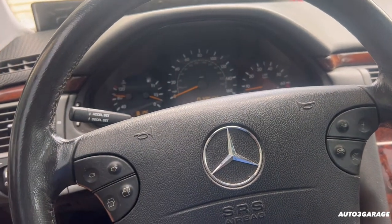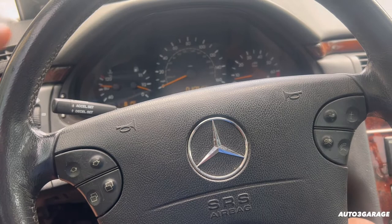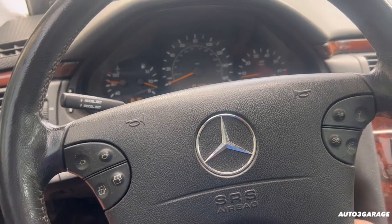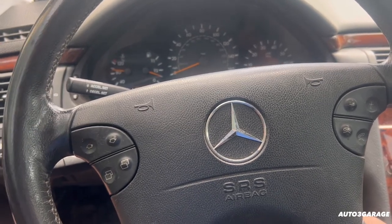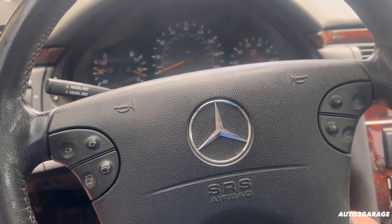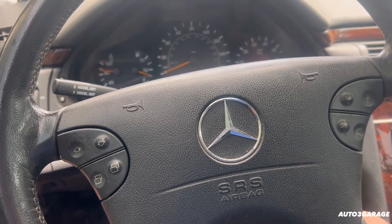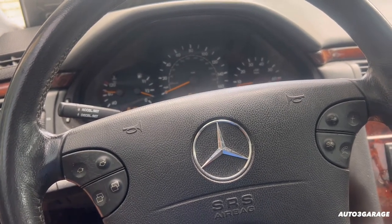I'm thinking I need to top it off, but I'm not going to do that because I don't know the exact coolant color. What I'm going to end up doing is flushing out the leftover coolant — like I said in a previous video — and changing the fluids. Preventive maintenance, you know. I want to keep this car running like it's supposed to. I need to figure out why that fan isn't coming on. Hopefully it ain't a water pump issue. I was spinning that bearing earlier and it kind of sounded off, but it's probably something simple.